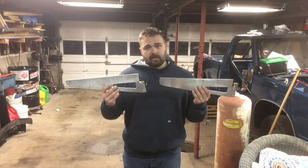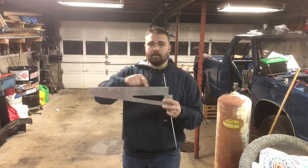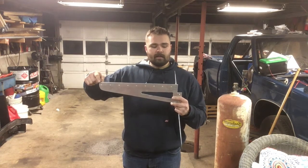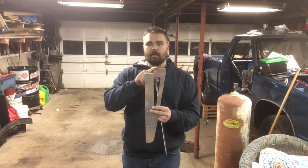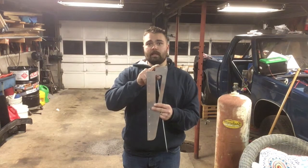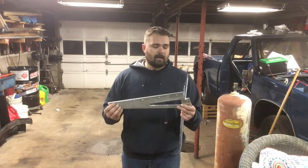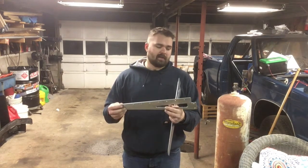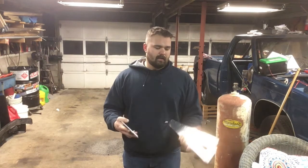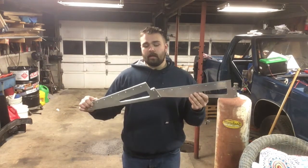We still need to put it in the bender, and I need to bend this top inch over 90 degrees, and then also our attachment flange needs to be bent at 90 degrees. I think they need to be opposite 90'd. I don't think they should go to the same plane. I think they should go to different planes. And this one needs to be a mirror. So they need to be mirrored of each other.